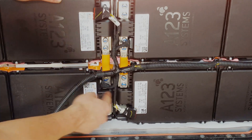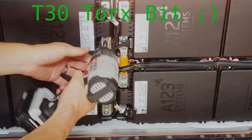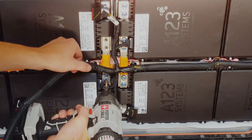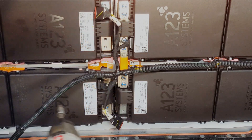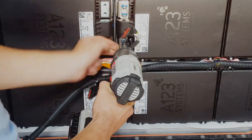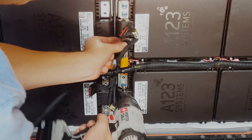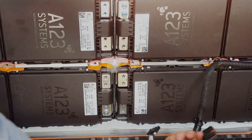To get these two out of here, you've got to remove the bus bar first. Get that out of the way. So now that that bus bar is out of the way, those bolts allow you to unplug that one. And then it's the same thing up top. That's all there is to it — you just do that all the way down. There are one, two, three of those types of connections. This is free now to come out. And that's it — these are ready to take apart.